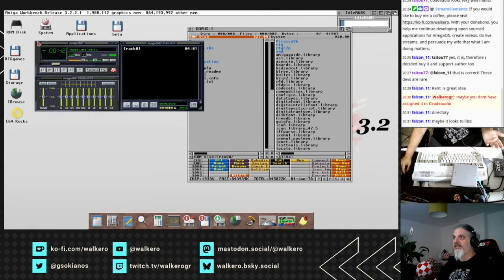But we have seen right now the audio players. We have seen how you can use this kind of CD-ROMs. If you have the chance, if you have an Amiga that has a PCMCIA like the 600 or the 1200 and you would like such a CD-ROM, which is perfect because it is small, you can have it even on your Amiga like that, I would recommend it. It works perfectly with games, with everything. The only downside is that you have to connect the audio at the side of the CD-ROM. But you can't have everything. Maybe if you get a small mixer that gets the output from the CD-ROM and the output from the Amiga and gives it to the speakers and you mix the audio from there, it might be a solution.